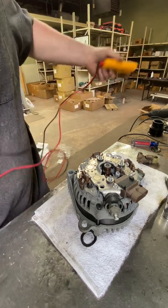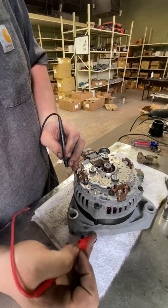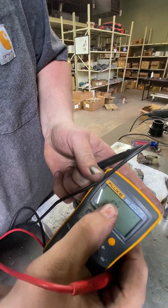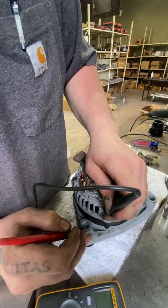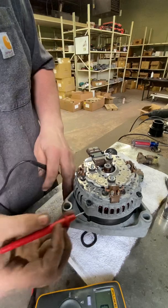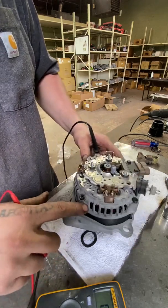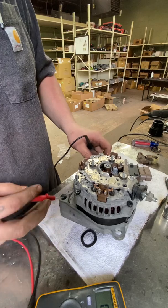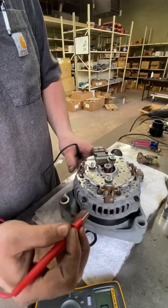The last thing to check — mainly for powder-coated units — is to make sure the mounting points are cleaned internally, then do a continuity test, which looks like a little speaker symbol on the meter. As long as you have continuity and a resistance reading of one ohm or less, you'll be good. A lot of times with powder-coated units the mounting points won't be cleaned, so you'll put an alternator on the vehicle and it won't charge. Make sure the surface mounts are cleaned, and if you can, remove the through-bolt screws and clean those as well, especially if the unit is powder coated or painted.